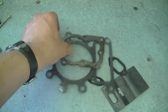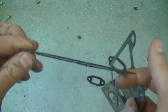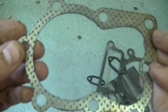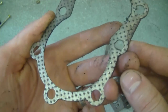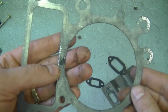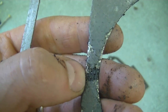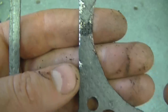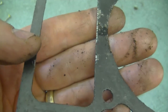While I'm talking about gaskets, I may as well cover head gaskets too, as I get the same question about them. This one's from a Briggs and Stratton lawn tractor engine, and this one's from a lawn mower engine. If I took off a head and the gasket was in this good of condition, I would reuse it — unless I see oil coming out the sides of the head. But this lawn mower gasket is in really good condition and can be used a few times over. Now, on the Briggs and Stratton tractor gasket, you can see pieces missing, and that's a dead giveaway not to reuse it. When damaged like this, your lawn tractor will burn a lot of oil and smoke heavily. It's also a different texture than the lawn mower gasket. Pretty well when you take the head off that type, you have to replace the gasket each time.